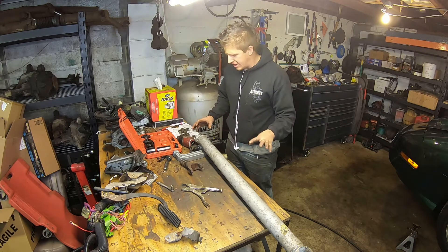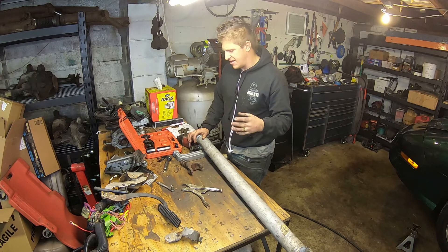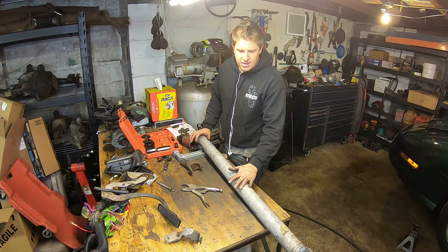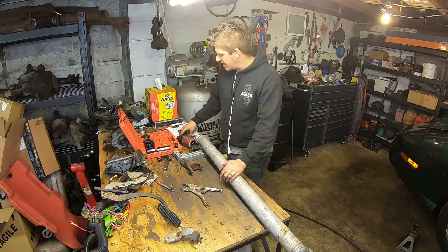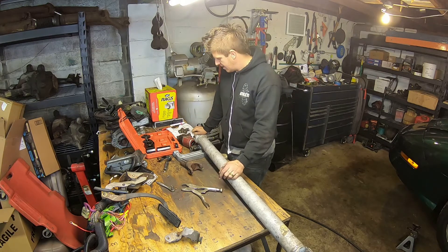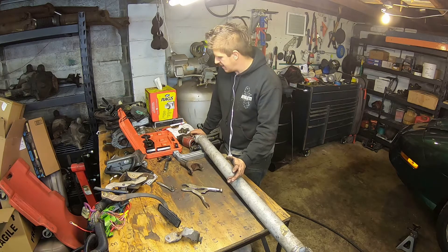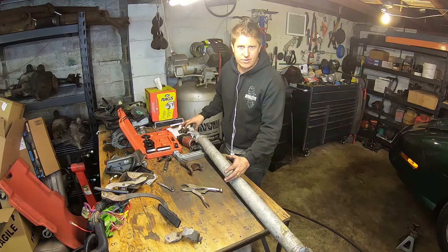I had a little bit of a hiccup. This is an aftermarket drive shaft. The steel drive shafts in these cars tended to have vibration issues, so aluminum aftermarket drive shafts are pretty common — it's a common change out, repair, upgrade that people made in these cars. They use a different size universal joint than the originals; they actually use two sizes of universal joints. So I'm going to have to measure those and get the correct U-joints ordered. Obviously the factory U-joints don't fit. I'll do a separate video for you guys showing how to measure universal joints for sizing.